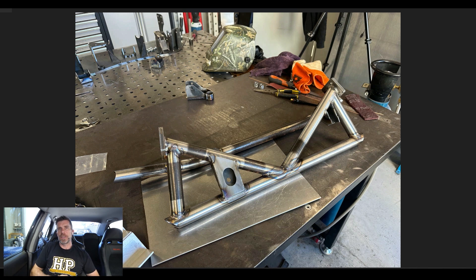One of the elements is how the subframe locates into the chassis. One of the problems we found with the original subframe — because it was coming in and out of the car quite a bit — is that it's an OE part with quite a lot of slop in the holes where it bolts to the chassis. Depending on exactly where you fit it back in and the tolerance within the holes to the bolts that hold it, you could end up affecting the wheel alignment, which you don't really want — having to do a new wheel alignment every time you pull the subframe and engine out.